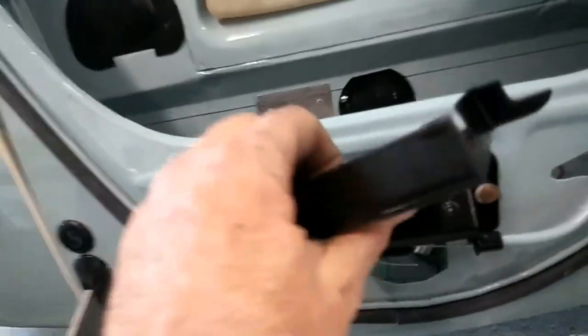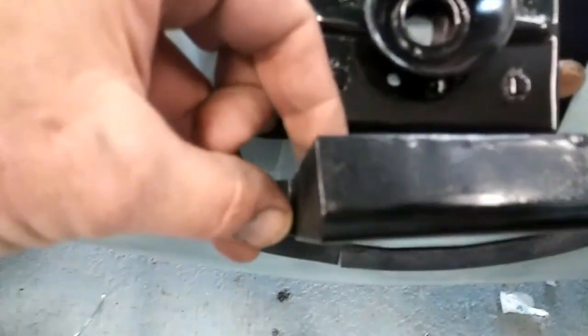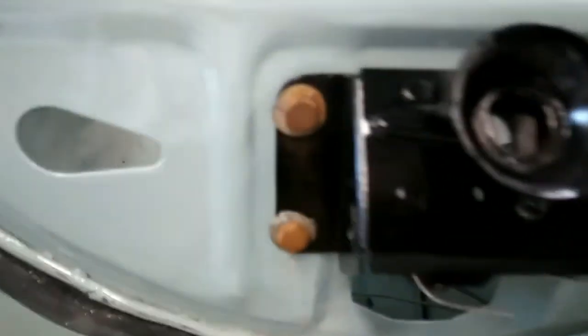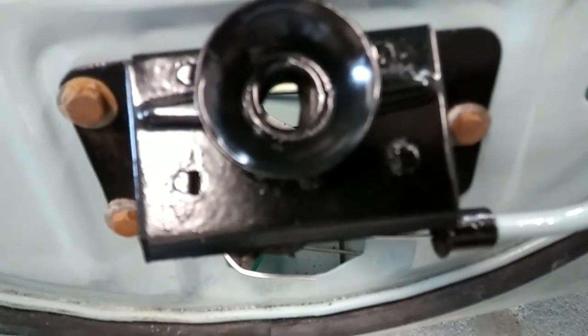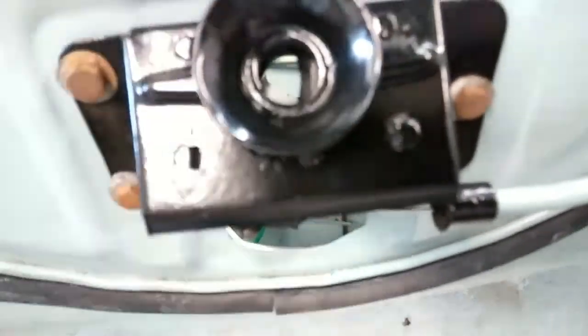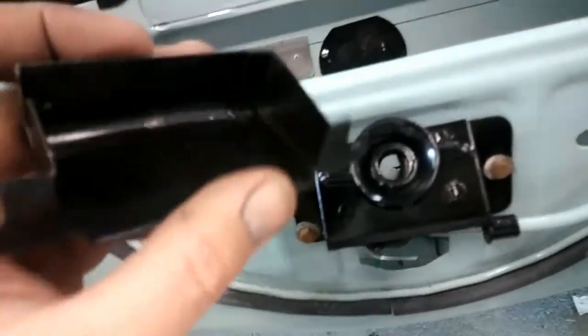So this little panel right here fits underneath on the inside of these two guys right here. It goes on the inside and you see how this is slotted — this thing slides up here, that's how you access it. So you open up, loosen all three bolts and nuts, and you usually have to put your screwdriver through the hole in the back and push on it and that pops this little fella out. So that has enabled you to get to the cable.